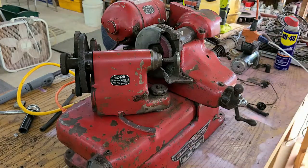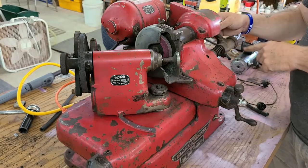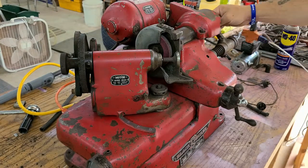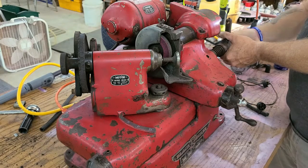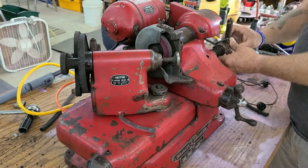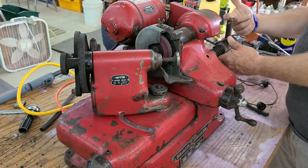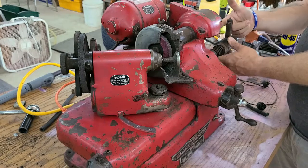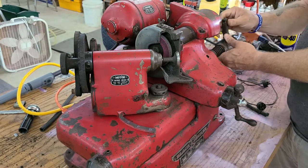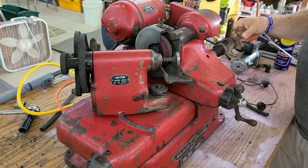I forgot to tell you — down here on this end, even though I'm missing a piece, it's got a grinding wheel on this end too. I finally got this freed up to where it actually collapses against the spring now, and this is a graduated knob here. So if you need to take off three thousandths, you can get your attachment, put your valve stem in here up against the grinding wheel, adjust how much you want to take off, and just zip it in there and take it off.